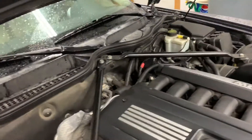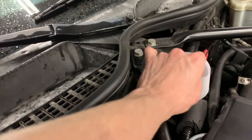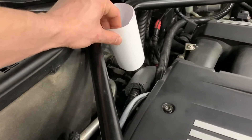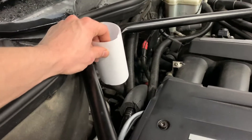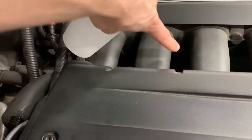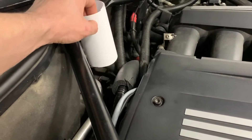The next location where I originally wanted to place it was right back here between the two strut tower braces, because it perfectly nests in there and I have two nice hard mount locations for a bracket. This runs into the same problem — there's just no way to empty the can without removing the whole thing, which defeats the purpose of the dropout bottom. The benefit of this location is it's very close to the valve cover outlet, making plumbing easy, but the bottom clearances just don't work.